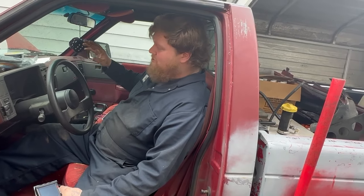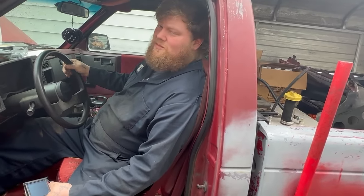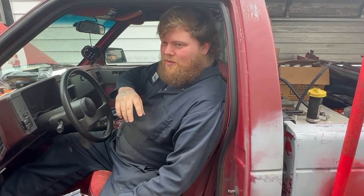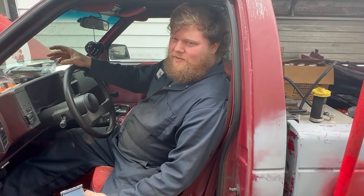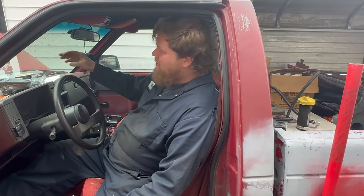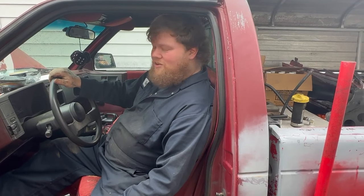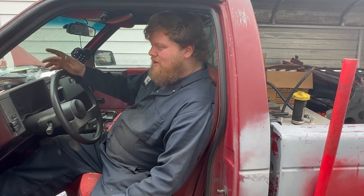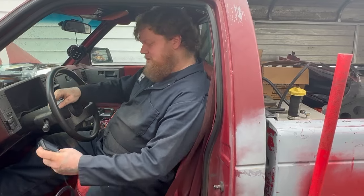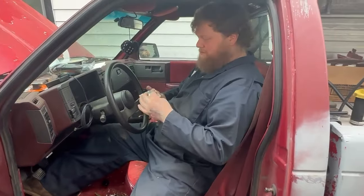It's all self-contained, super easy to install. It takes like 3 or 4 screws. Find a location for it, run it in, super simple. And then you bypass all of your issues of trying to put an inline pump in or do anything else. You don't have to modify your fuel system at all. You literally just unplug your fuel send to your carburetor, run it to the surge tank, and then plumb the surge tank into your car. Super easy. And then it's all self-sustained because the Sniper turns it on and off. You don't have to have switches for it, nothing, unless you want to do an inline fuel pump. It's easy. No rocket science, no magic. Just A to B wiring.